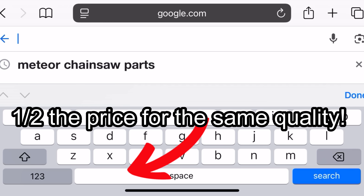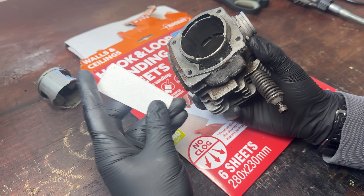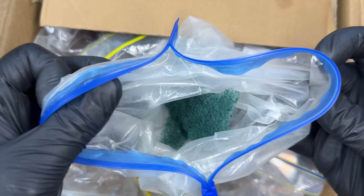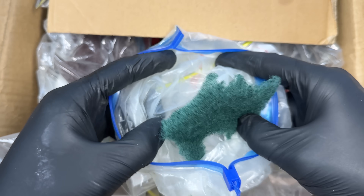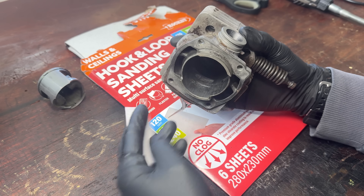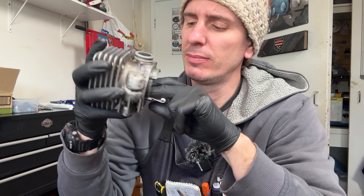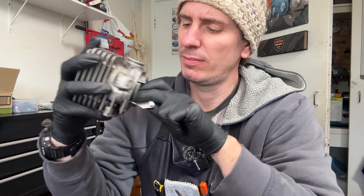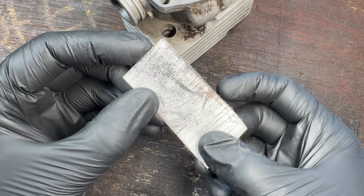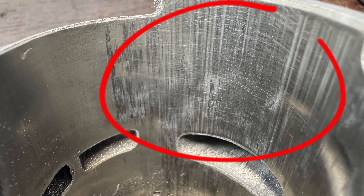The first method — and it is the safest because you're doing it by hand — is using some medium grit sandpaper. 240 grit is absolutely fine, or if you've got some Scotch-Brite that works really well too. Simply rub it over all of the transfer you can see inside the cylinder. Don't be concerned about damaging the plating by hand; it's incredibly hard and incredibly tough. Focus on all the transfer areas, all the dark streaks, and you will get rid of them.